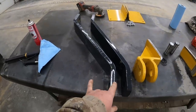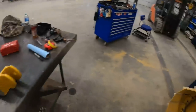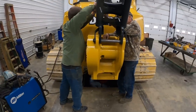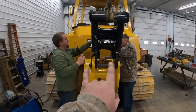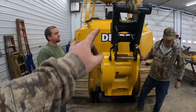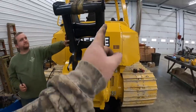You guys see these two arms laid out - this one here has more of an offset on it and it's going to go on the left hand side of the machine. This log arch is kind of sitting off to the left side so it takes more of an angle to go out to this left side over here, so the bracket with the more offset is going to go on the left side. You can see how this side is more flush.